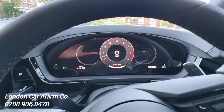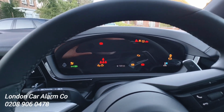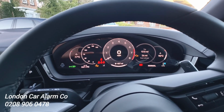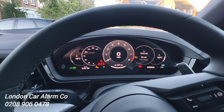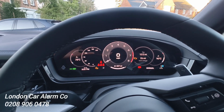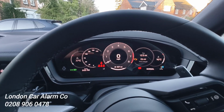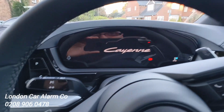Okay, when he gets the vehicle back, he does exactly the same. Just main ignition on, vehicle can't be running, insert his code and hold on the last press. Just keep holding. And shortly it'll come out if you watch carefully. There you go, it's now come out of valet mode. As soon as I open the door, system is now armed again.